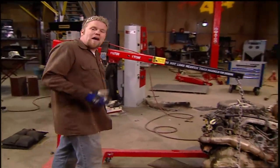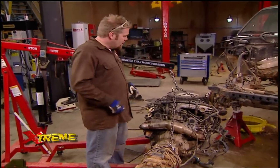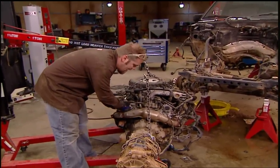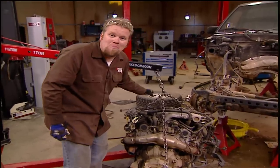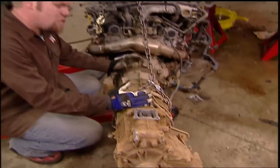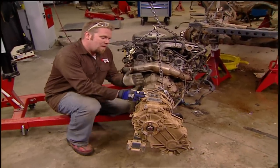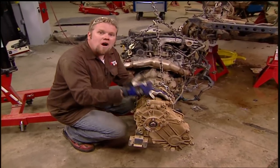If this was a four-cylinder truck with a bad motor, it would honestly be worth rebuilding — those are great motors off road. But the 3-liter V6 is not everyone's first choice. It goes through head gaskets quite regularly because the aluminum head and cast iron block expand at different rates and tears the gasket. It's known to use a lot of water pumps, and those aren't cheap to replace, and the fuel mileage is not that high. Behind the engine we have a standard transmission — not a huge fan of running a stick off road, it's just personal preference, I find it a lot harder to climb hills. Behind the standard we have a chain-driven transfer case, which is definitely not our first choice. If you run a Toyota, you want the gear-driven unit.